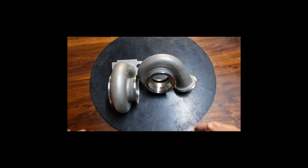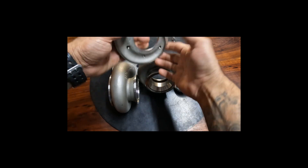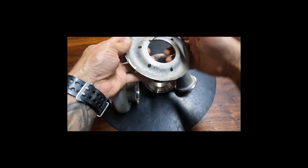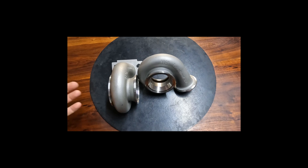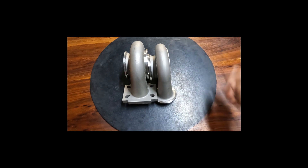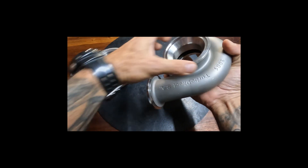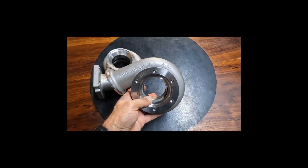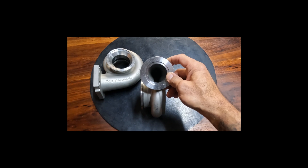Let's start with the Turbo Direct proprietary stainless steel turbine housings. I'll put a link in the description to our video on understanding AR of turbine housings, where we cross-section some of our housings to show you the internal shape and features. We have two turbine housings here side by side: the AR61, which is the narrower, slightly smaller volute, and the AR79. These turbine housings come in V-band 76mm and 90mm V-band out, as well as T3 in and V-band out. These are proprietary Turbo Direct turbine housings — entirely clean sheet designs first exhibited at SEMA in 2012.